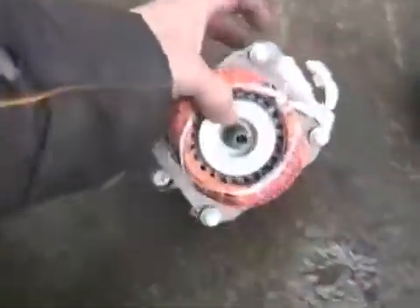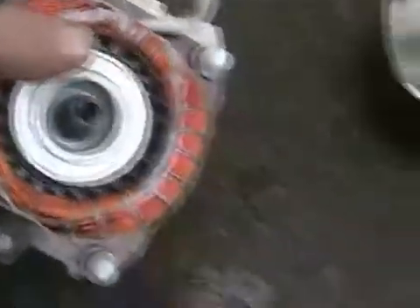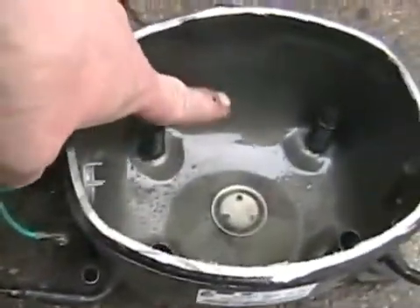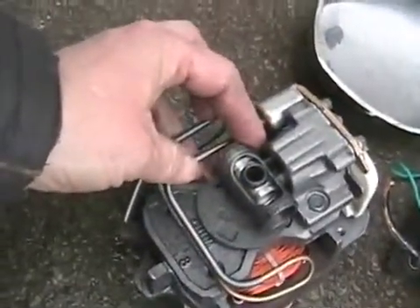The lid just reminds me of a cranium or a bell. If you look right down that little hole, the crankshaft is hollow, and there's a spiral of just sheet metal in there. The spiral sits in the oil in the bottom — the oil's usually an inch or two deep — and when it's spinning, it screws the oil up, and the oil comes all the way up out the hole at the top of the crankshaft.